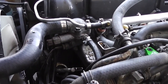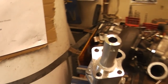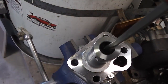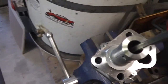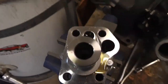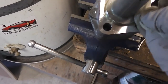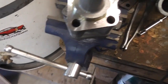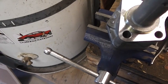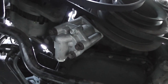Now we're going to put the new oil pump on and fit the distributor. On this type of oil pump, you stick a flathead screwdriver into the drive, pour oil in the sump end, and turn it counterclockwise — you can see it's pumping oil well. You work it until all the air is out of it, and then you're ready to put it in the car. The shiny new Hitachi Turbo Automatic oil pump is now in the engine.